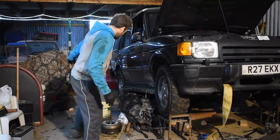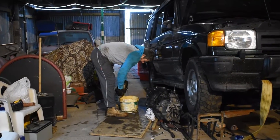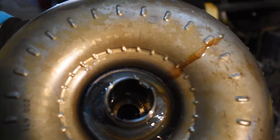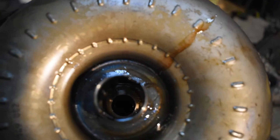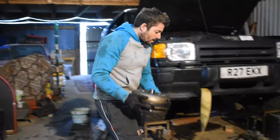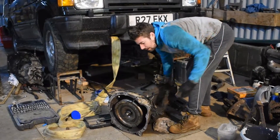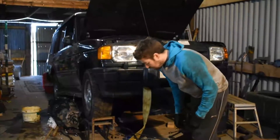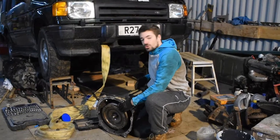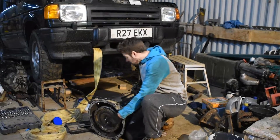So this is the old one — I'll show you this. If you can see, you've got one set of teeth and then deeper down there's none. Well, there should be some. So that actually went on there. As you can see, that doesn't really move around at all. So that's bolted to your flywheel — the engine turns around, and effectively it should transmit drive through the gearbox, which it's not doing. Because that's spinning around, teeth all stripped, and it's not giving any drive at all.